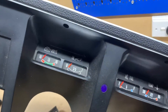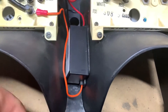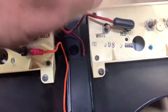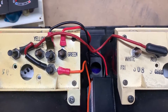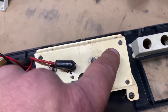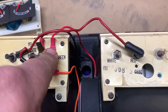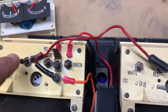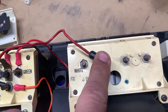Here's an actual dash fascia with the gauges installed, and here you can see what I've done — there's the electronic regulator. It easily sits behind your dash fascia, attached with some double-sided tape. All your connections on the back of your dash from your car will still be standard — nothing changes, it stays exactly as it is. You just connect your red and white wire, your yellow and white, your green, your white, your black and your green. Power goes in at 12 volts, and then your regulated power comes out here, feeding your gauges.